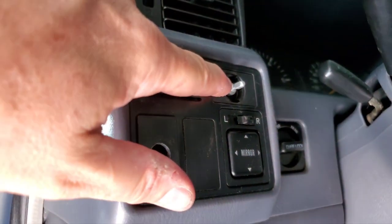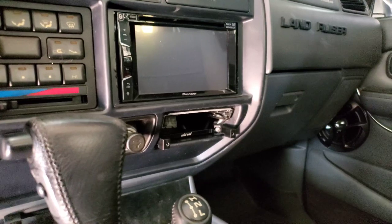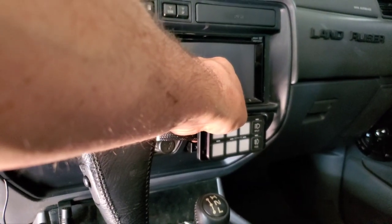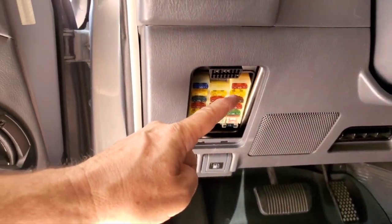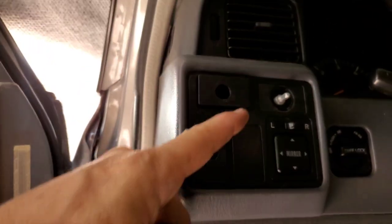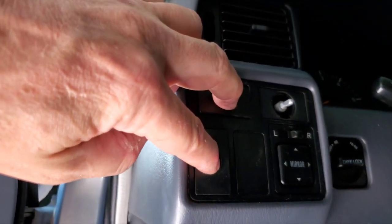For Land Cruiser people, you'll tap for your ignition right at the cigarette lighter. Up here — I already have it off — this is where you tap for the backlighting of the actual switch panel itself. Wits End makes an awesome replacement for your ashtray, so unless you're a smoker it's going right there, nice and clean. It's pretty easy on a Land Cruiser to run the wire behind the dash without really taking anything off.